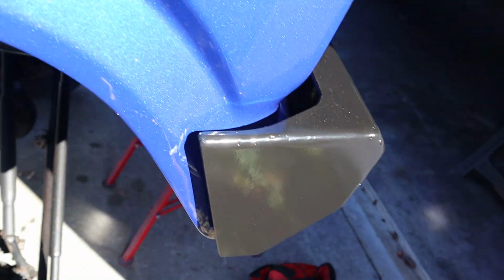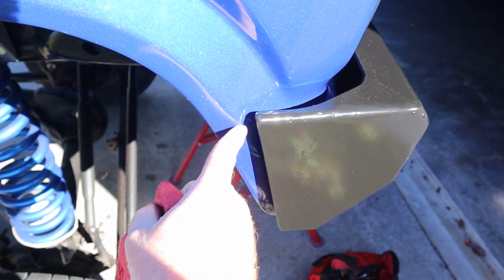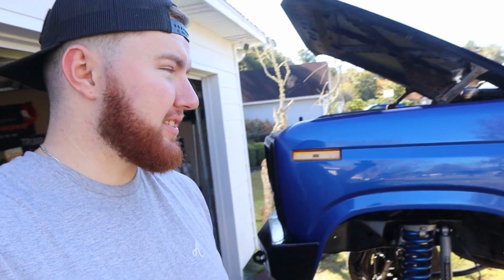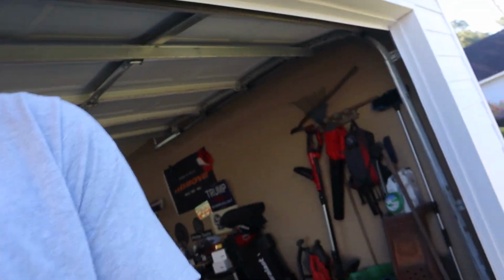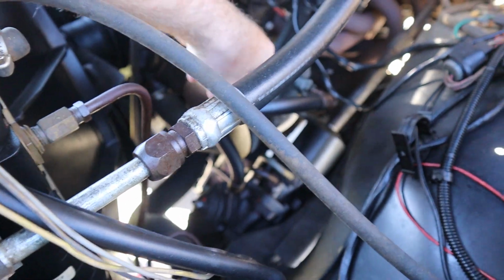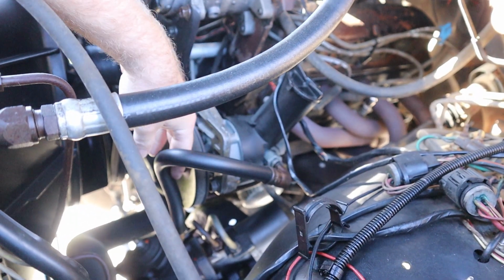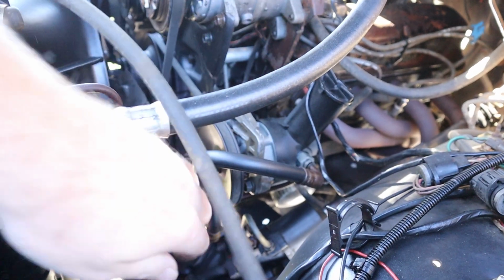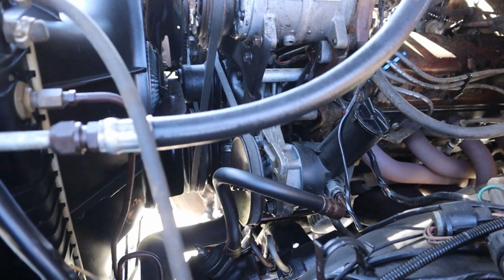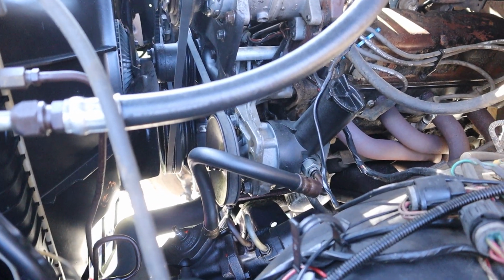This thing is looking good. And we are not touching over here. Yeah, see where I scratched the living crap out of the truck getting the bumper off. I was not too happy about that, but now let's get our power steering hose replaced. I'm gonna do that off camera because you guys can't really see it, but it is this hose right here. There's a hole in it right down here. Somehow the pulley was hitting it and it rubbed a hole straight through it.